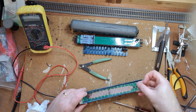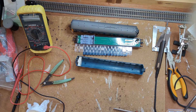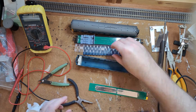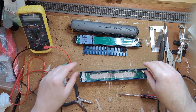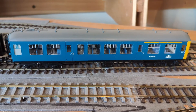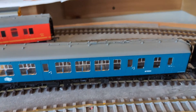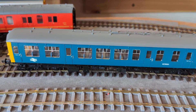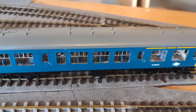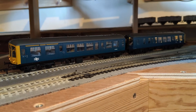The wire bridges need to fit underneath the lighting spreader bar. There's enough space here to clear a surface mount resistor, but neatness is required. If, like me, you can't manage perfect neatness first time, some gentle filing may be necessary. Reassembling the trailer car is pretty straightforward — for once, reassembly is actually the reverse of disassembly. In a darker area, away from direct light, the trailer car is still noticeably dimmer than the driving car, but it's a lot closer than it was.